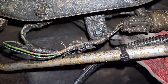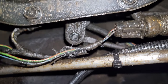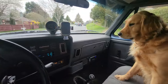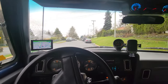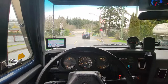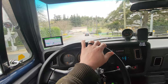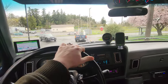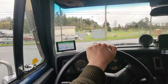The adjustment with the neutral safety switch — starts in park and neutral — so we should be good to go. We'll go for a test drive to make sure it's all working and it doesn't pop out of neutral anymore. The problem I was having before is basically when under a bit of a load or high throttle from a stop — sometimes I'd be at a stoplight, take off, and in the middle of the intersection it would pop into neutral. So I'll take off from the stop light and give it some pretty good throttle to make sure it's not kicking into neutral.